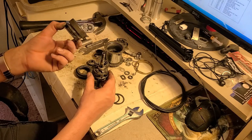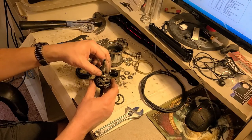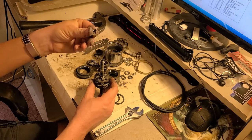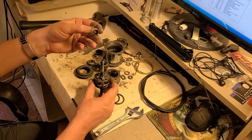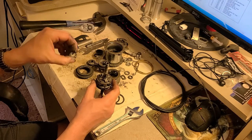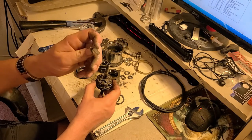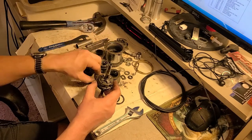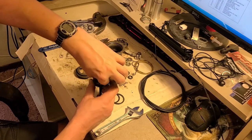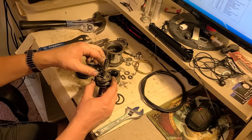The clutch has a one-piece housing on it — isn't that interesting? Usually they don't have a one-piece housing. The thrust washer is missing — there should be a thrust washer there. I'll have to look at the other one and see how thick it is. The clutch key, indicator, shifter key, toggle key — whatever you guys want to call it, it's all the same little piece. It has a nicer style clutch, not the little cheap-looking forged clutch.